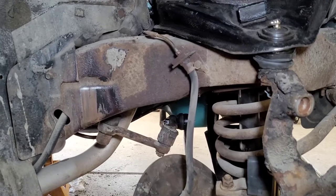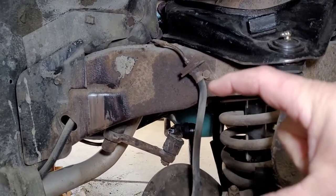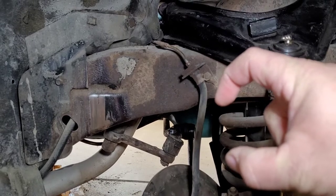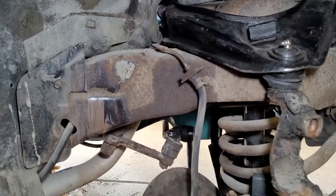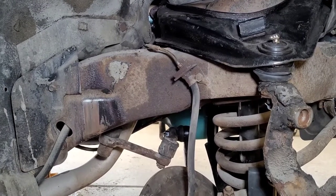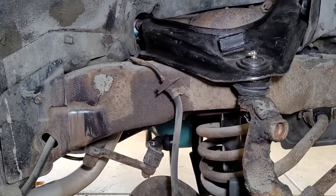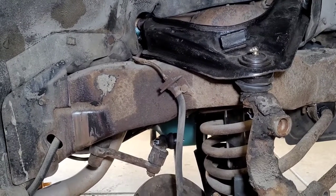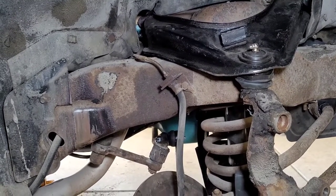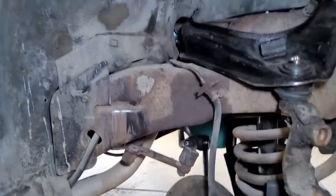Let's grab a flare wrench — not just a normal open-end wrench. We need a flare wrench because it's got the claws that go all the way around in a C shape, so we can equally distribute the force as best as possible. Let's give it a try because I really don't want to break this brake line. Not looking forward to trying to do that on this car — it's easier when the engine's out and the body's off. You can clearly see the body is still on it.